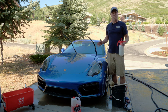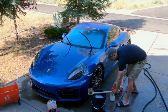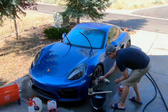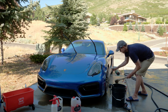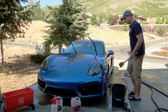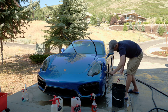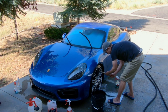There's waterless, there's all kinds of ways to wash your car, and then there's automatic car washes — which this baby will never see as long as I own it. So what I like to do is get the wheels soaking with the oil and grease cleaner. This little handy pump-action squirt bottle gets the oil and grease cleaner going on there. It is safe for wheels in addition to the wheel cleaner. What's nice about having this long brush is you can actually get into the inside of the rim, which is great because that's usually where people don't clean their wheels. Any automatic car wash isn't going to get the inside of your rim either.